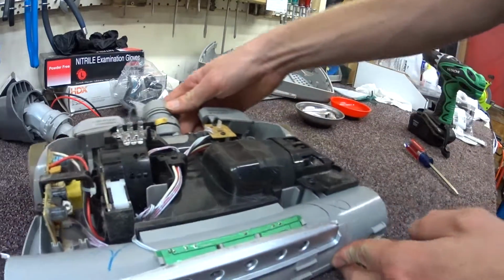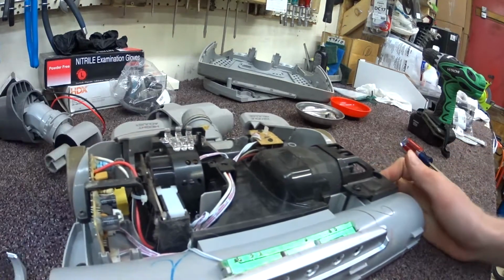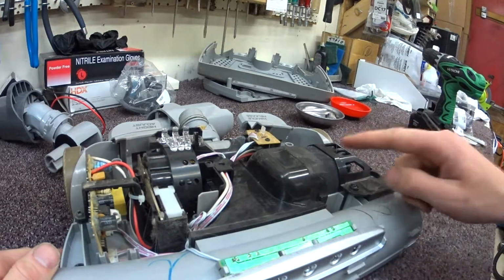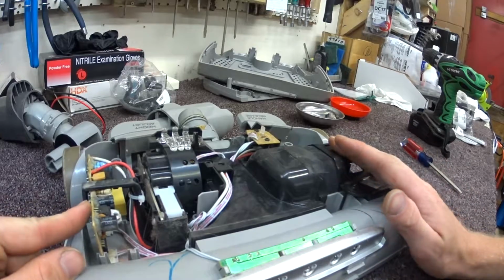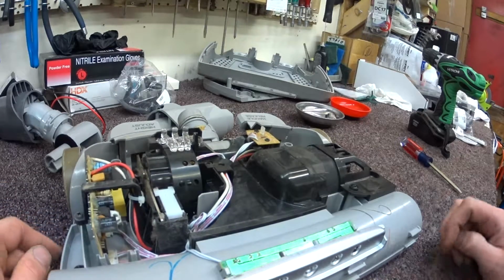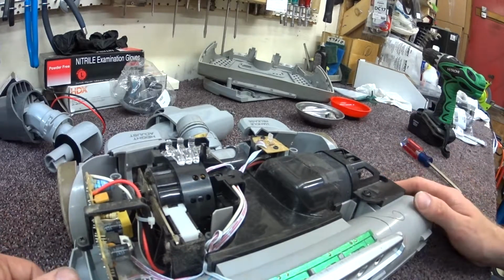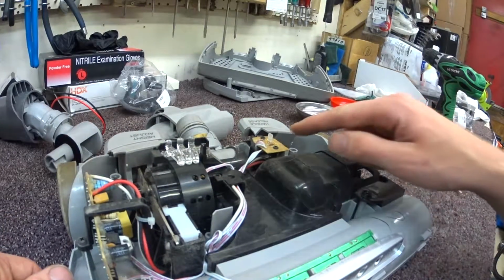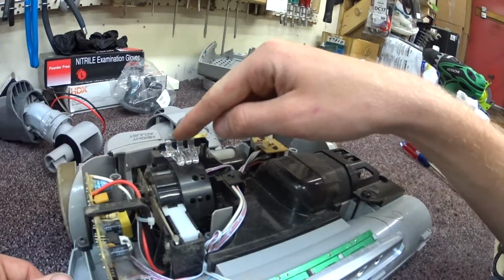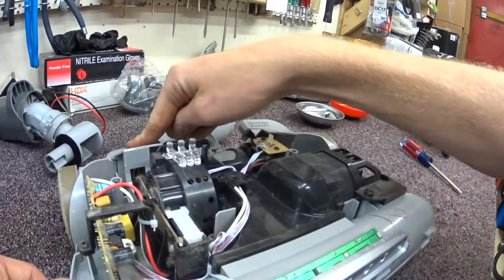Alright, when I say overly complicated, usually we have in a power head a motor, a brush roller, a belt, and sometimes some extra circuitry to stop the motor if the belt gets stressed, if it's a lifetime belt model. So what is in here extra, oh, you know, light, that's not really extra, but is this circuit board. So there's two circuit boards. There's like a third circuit board in here with some LEDs that light up this very elaborate height adjustment.